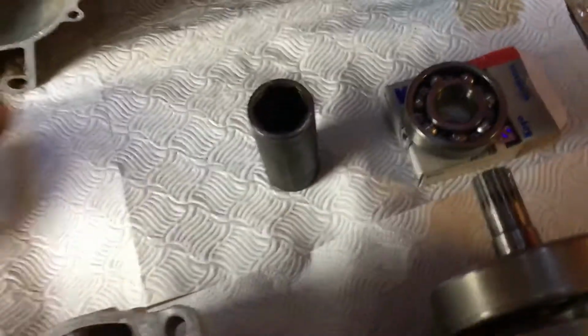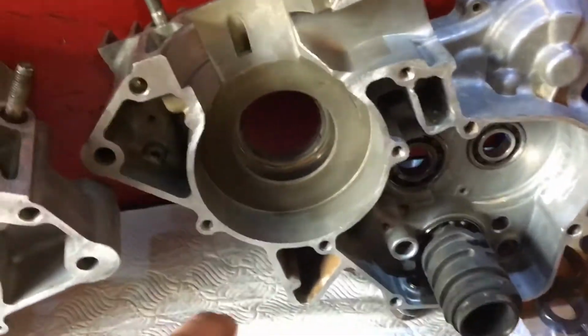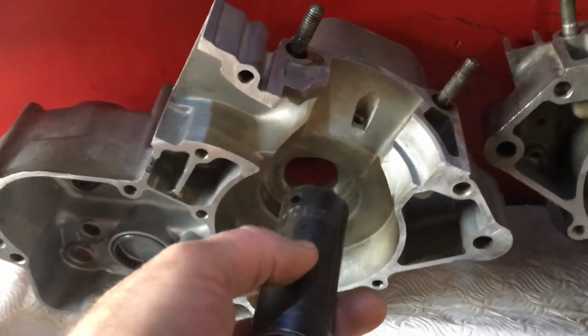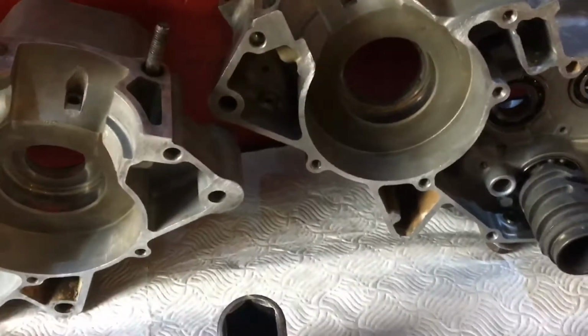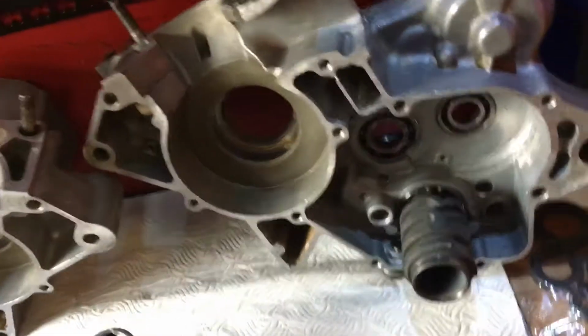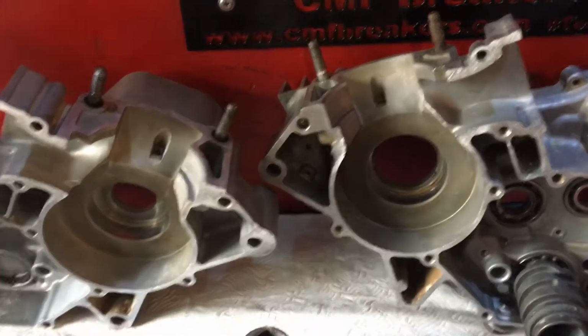And same again when you're closing your casings up. If you've not got a case puller, which we have, crank puller, toss one there. If you've not got one of those, then same principle with the left casing, depending on which way you close your casings, socket on the inside race again. And, like I said, closing your casings over should drop straight over, no messing about. Maybe a gentle tap with a piece of wood, just to close the casings up.